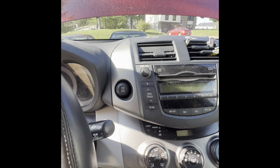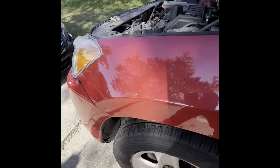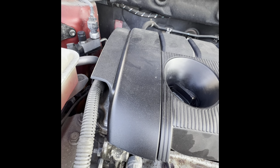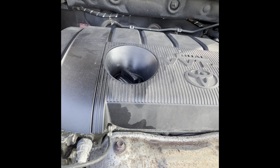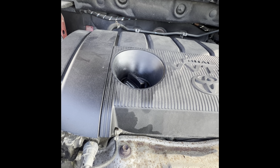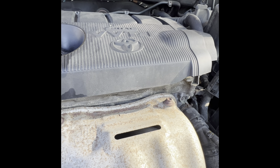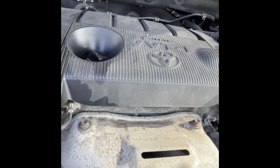Here is my strategy. Let me get out of the car. First, I'm gonna drain the fluid. Then I will disconnect the return hose, maybe drop the pan, and get the filter cleaned without replacing. Clean the pan and everything. Then I start my flush, disconnecting the return hose. After I completely finish the flush, I'm gonna drop the pan again, clean it, and replace the strainer. Then everything should be really clean.